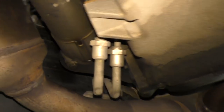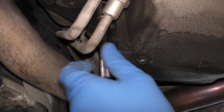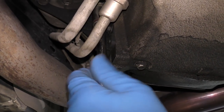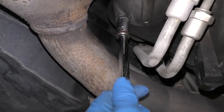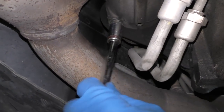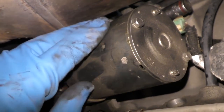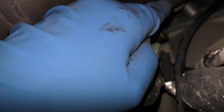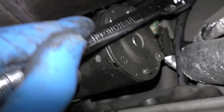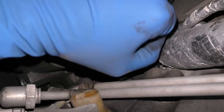As we slide under and look, here's the starter. It's got two bolts on it that we take off — take the inside one first because that's often kind of hard to get to, so you want to get the harder one off first. There goes one, and there goes the second one — it's a 13 millimeter socket if you're curious. They've got long threads. But of course there's not enough room to get it off without taking the wires off too, so we've got to take off the power line up here.